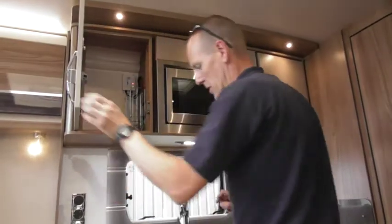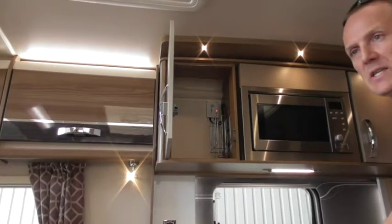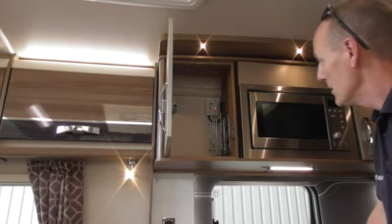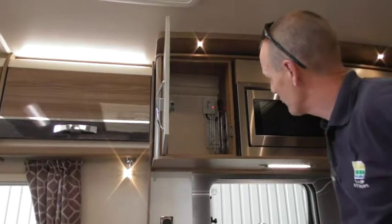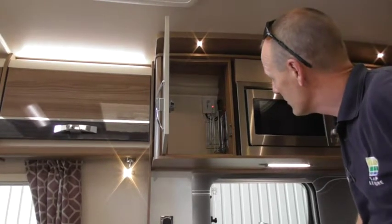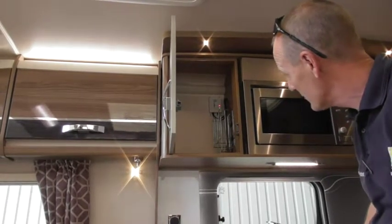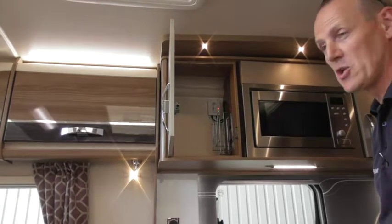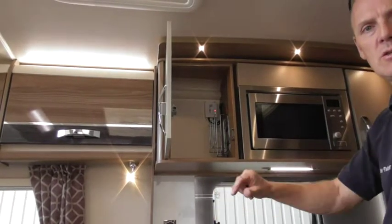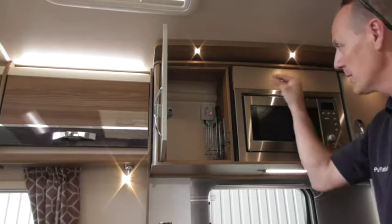Here's the solar panel — that's your regulator sitting on the roof. It's totally automatic, you don't need to switch anything on or off. As long as you've got daylight it will work. The red light means it's giving the full 14.5 volts because the battery is slightly down; it turns green when the battery's in better condition. The green light flashing underneath means it's charging. The lights will go out when it's dark or when the battery is in good condition and fully charged.